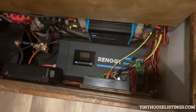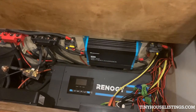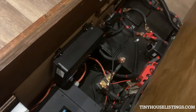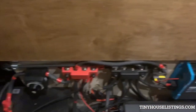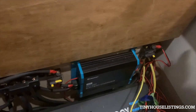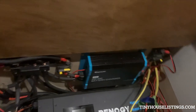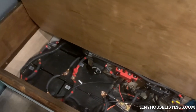Here you'll see the electrical system. There's a sine wave inverter, a DC-to-DC battery charger so excess power from the front van engine can be routed back to the batteries, and here's our breaker box. This is for solar — it takes the solar from the roof and puts it into the batteries. There are five very large batteries here, a main on/off switch, positive/negative bus bar, and inline fuses in case you want to pop one — for instance if you don't want to use the DC-to-DC charger or you're working on that system, or it just trips. This all connects to a shore power line that goes out of the back where you can plug into 30 amp and charge the whole system — it charges pretty fast.